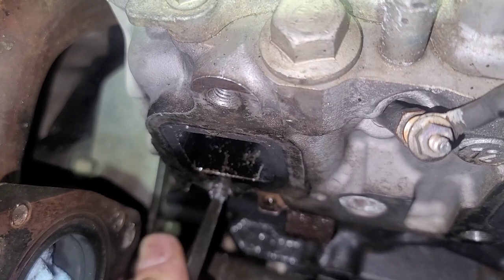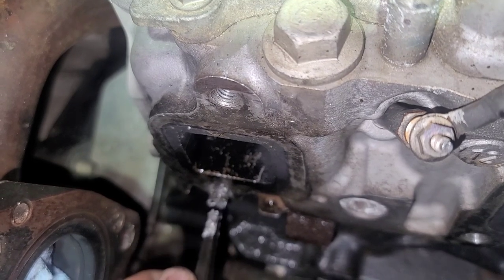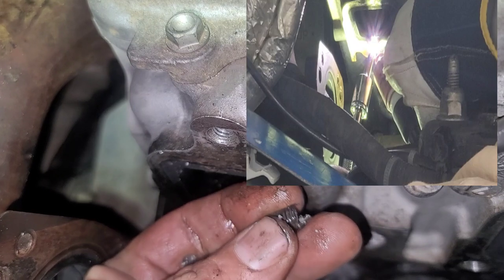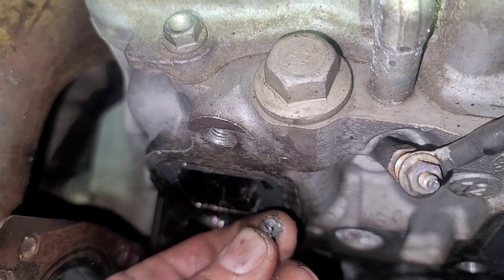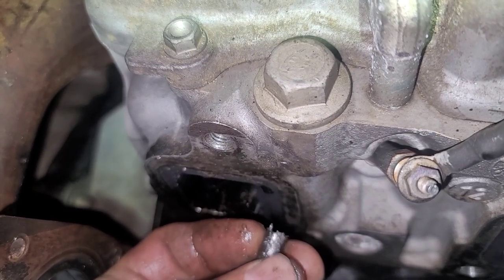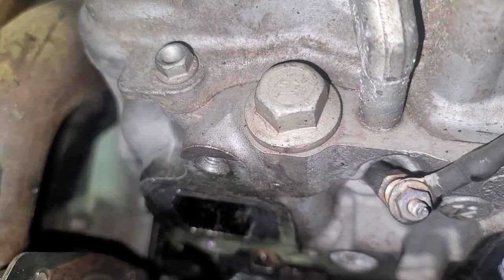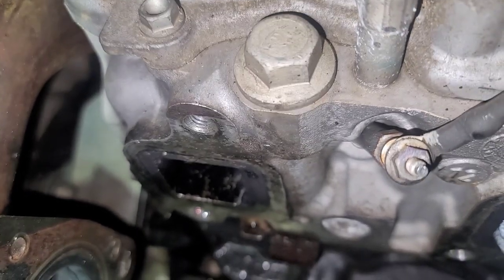I had been messing with this thing for like 4 days. I would come out and work on it a little bit, and the stud extractor broke — the first one I used. I had to deal with trying to get around it. I figured I'd have someone come over and weld a nut to it so it would spin out easier, thought it would be better for the head and quicker. They failed, couldn't get it out. So then I had to go back through the weld and the bolt and the stud extractor. Another gentleman came by and dropped off some carbide ball cutters — I've got a link to those in the description. Those things chewed right through the weld, through the extractor, through the bolt, and all of it. They made it a whole lot easier.